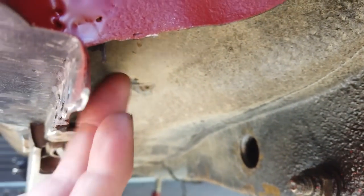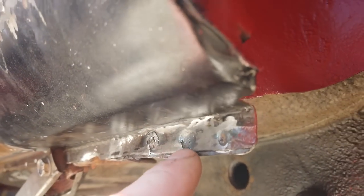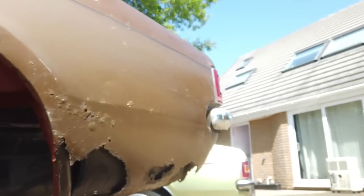It was only that bottom that we had to do, and of course we had to make this shape so it follows nicely. You can see how that's blended in, virtually invisible. That backing plate at the back repair, my fingers are touching it now, little triangle went in, then spot welded back together using the new backing plate for the surface mount point for the repair patch of the sill, so they both sandwich together nice and factory. So very good there.